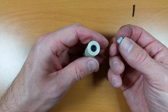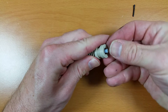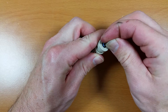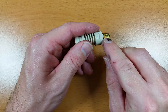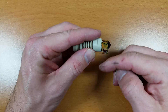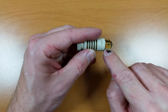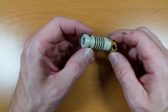And then this little bit of PTFE goes in the top — that just acts as a guide for the filament. Then reinsert the heater resistor and thermistor. To help make sure that the thermistor doesn't fall out, it does help to put some tape around this or secure it in some fashion, maybe with a high temperature resistant adhesive or something of that nature. But this would be good to reuse.